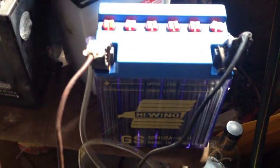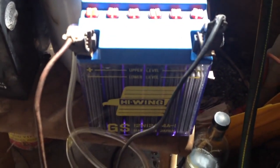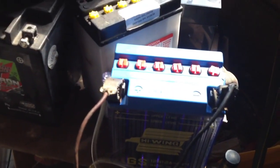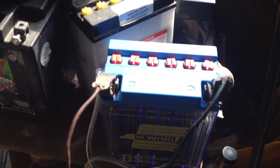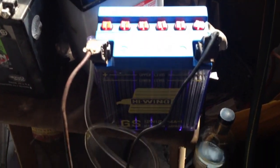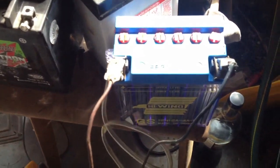Then you put it on the charger. I charge them at the least amperage possible — usually about one amp for twelve hours. Some might need more, some might need less. Just check it every couple of hours to see how many amps you have on the battery. Different batteries will obviously have different amperage, so you'll have to pay attention to see what battery you have and charge it up.